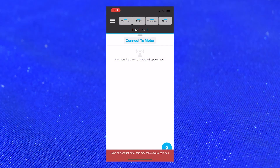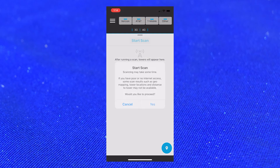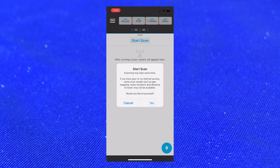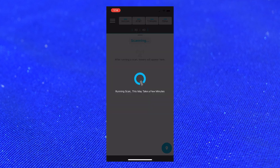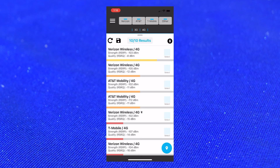Once it's charged up, you turn it on, download the app, and connect it. Once connected, it goes into a survey mode which takes about a minute or two — it says up to five minutes but it never seems to take that long. You will see all of the services and all of the towers available to you. If you've got a good cell connection on your phone, you can also generally get geo information — in other words, where that actual tower is on Google Maps.